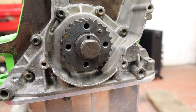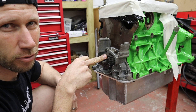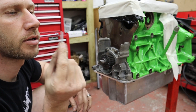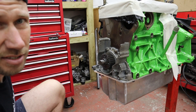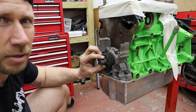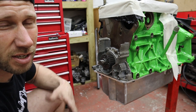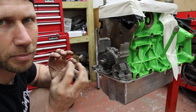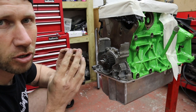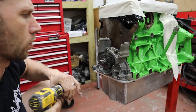The only thing to be aware of before you drill is just how deep you're going to go. The crank's got loads of meat on it so you really haven't got any problems with regards to depth. I'm using 4mm by 30mm long hardened steel dowels. You can use different sizes — I've seen 5mm being used, and I've seen some that were 40mm long. The crank pulley itself is about 15mm, so I'll go in another 15mm — that's enough to get that little bit of extra surface area on the crank pulley. So even if the crank pulley comes loose or the keyway breaks, the pins will hold that pulley absolutely solid. Let's get drilling.